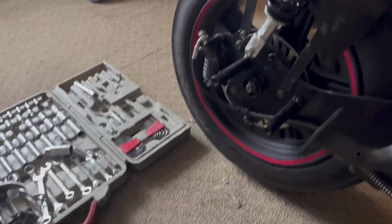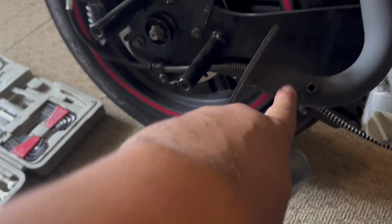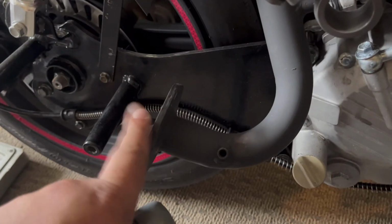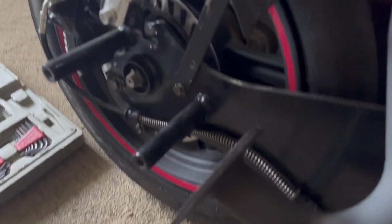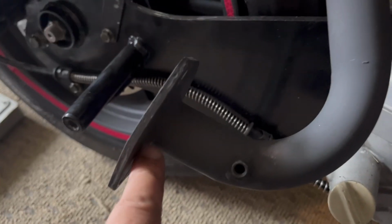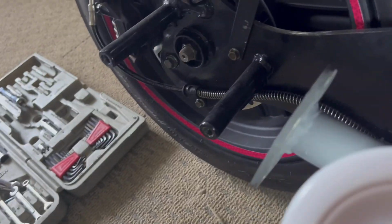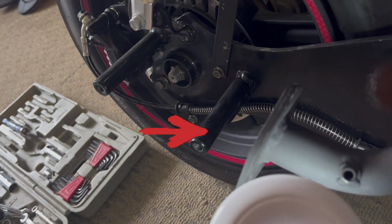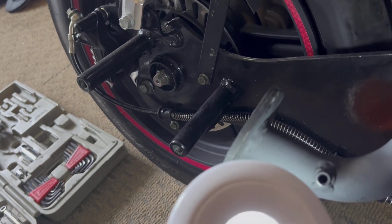Hi guys, so next, X22 owners are gonna notice that this connector over here has this before the gasket. And you see this little area in here, let me put some light on this. I'll show you. See where the edge of this seal is? Where the weld is? That's where you want to cut, because when you put any slip-on on, you won't have to go over that barrier.